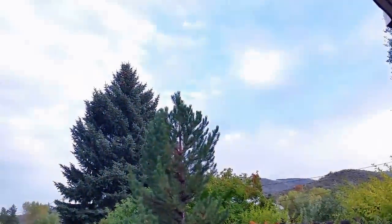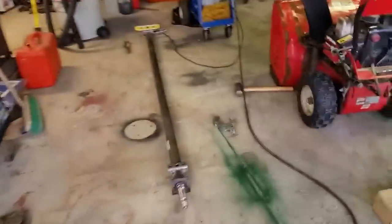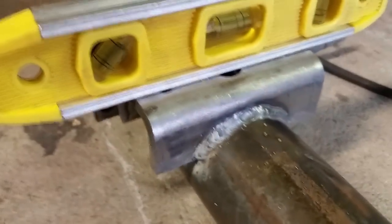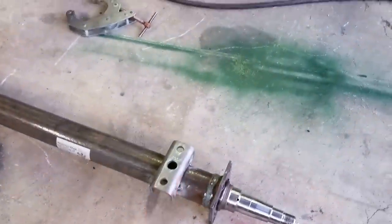It's cleared up enough out here that I'm going to start welding on these axles. I marked 'top' on there like I showed before and I've just tacked these in. That one down there I've got welded in all the way — it just keeps the axle from turning. I leveled them out, got the top marked, measured equal distance from here to here, and now I'm going to finish welding that in.